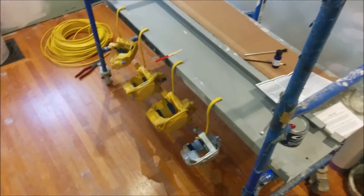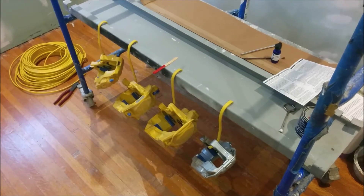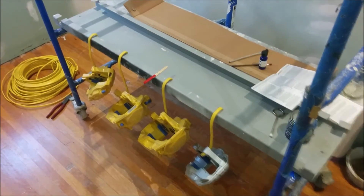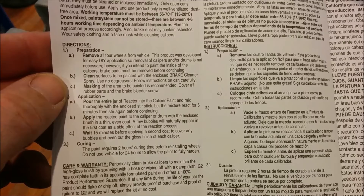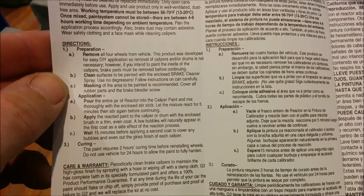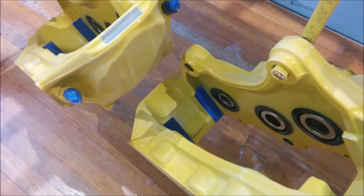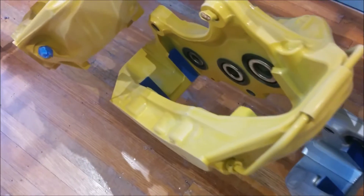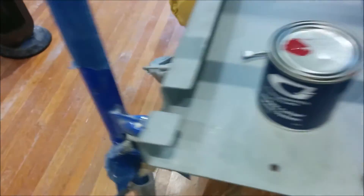All right, so all the sanding prep work is done. I've got these up here in this bathroom I'm remodeling — it's a closed environment where I can keep things away from pet hair. I'm using the G2 caliper paint in red. I have to clean the surfaces with the brake cleaner included in the kit. I've masked quite a bit — the pad slide areas, the bleeder screws — but since it's a brush-on product, all I have to do is not brush it on the pistons and boots, so I'm not too worried.